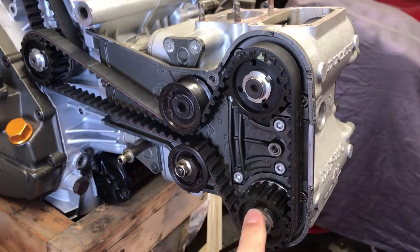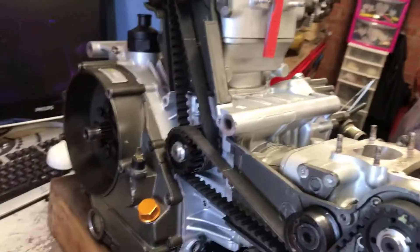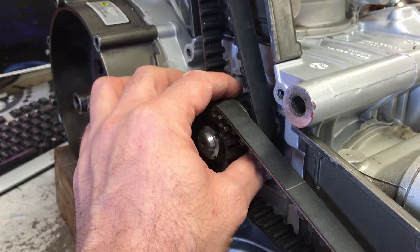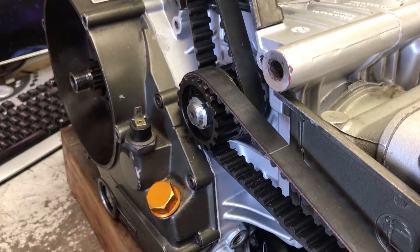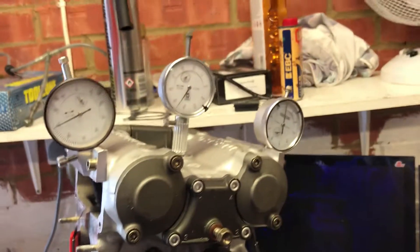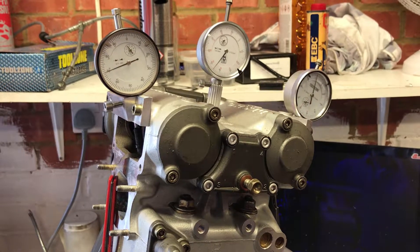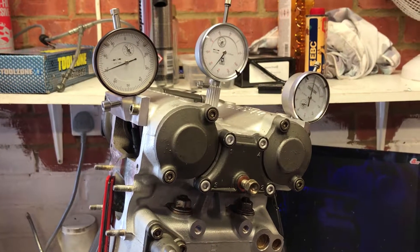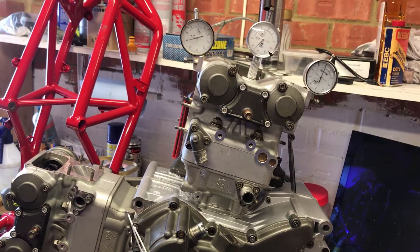What I need to do is change the standard wheels over to adjustable wheels. I had hoped to run standard timing, but I've got a variance between the engine cam timing — it possibly could be down to the keys that are in here. You can get offset keys to go into the main driver here, but they're quite rare now; I don't know of anybody that actually sells them anymore — they're rare as unicorn shit, if you pardon the pun. So what I'm going to need to do is change over to the nice fancy adjustable pulley wheels I had been saving for another engine, but we'll use those on this engine and get this cam timing dialed in to where I want it to be. I'm going to advance it a little bit and get some more meat out of that, so that is how you check the cam timing.